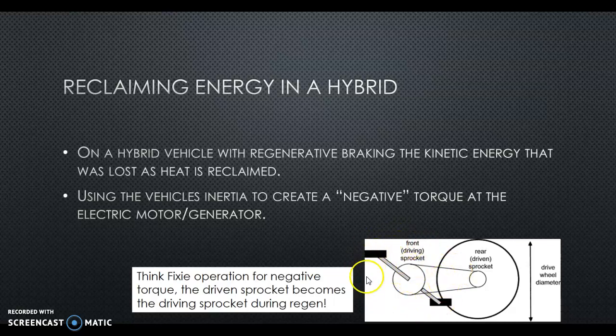Now let's say this crank is going down the road. If you want to stop a fixie bicycle, you can't just hit the brakes, because if you slow down, the rear wheel is still turning, which means the sprocket's still turning and the pedals are still turning. To slow down, you basically try to push on the pedals backwards — not actually backwards, but you're going to create resistance to them going forward. They're going forward but slower because you're trying to give resistance. That's a negative torque with a positive RPM. The rear wheel is driving the sprocket, you're trying to resist that forward motion — that's a negative torque, but it's still a positive RPM.